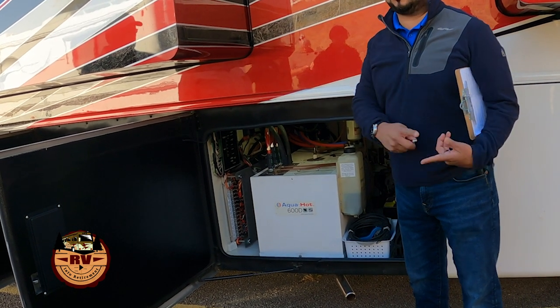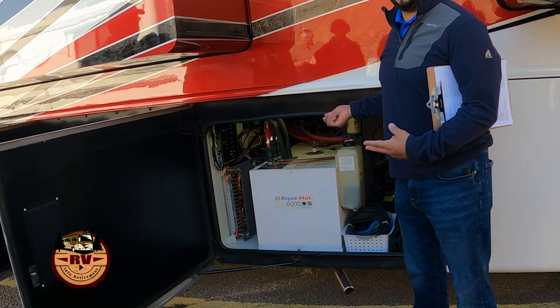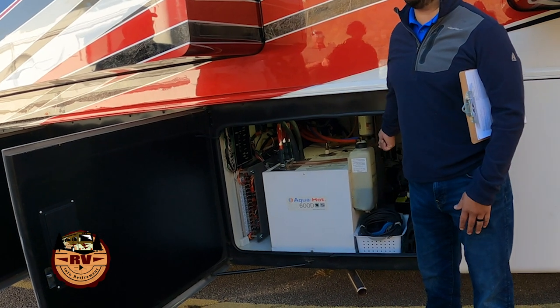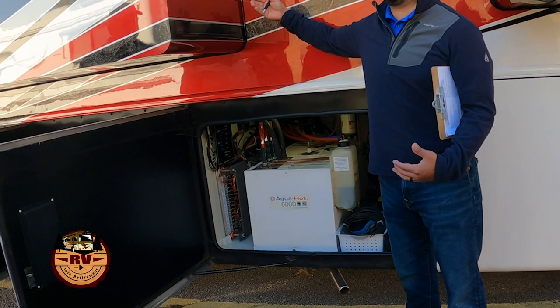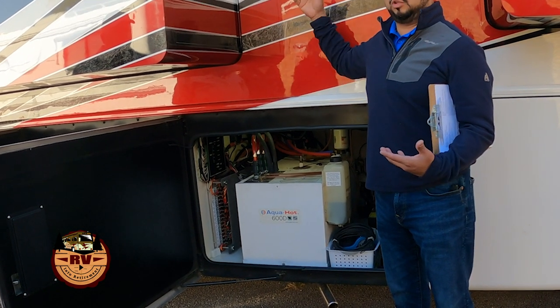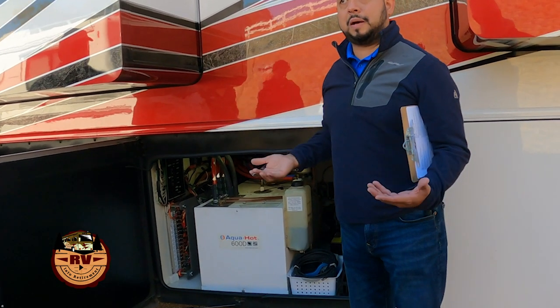You know, if your hydraulics are working but your air system is not, there is a bypass for that pressure switch on the air seal. So that computer is looking for the vacuum on this, and if it never achieves it, or if that switch is bad and it never, quote unquote, sees it, you'll never get the solid light on your HWH system. But there is a bypass for that.